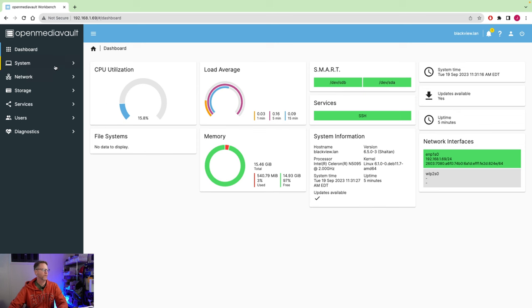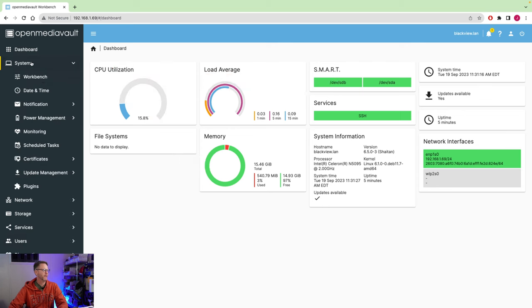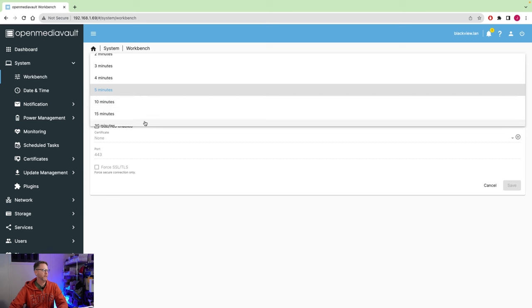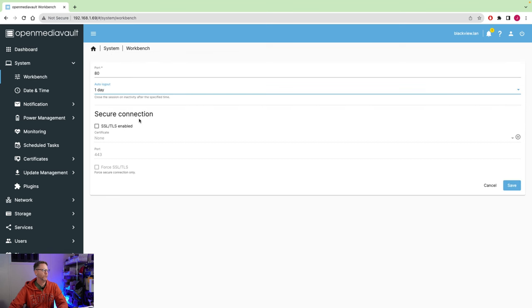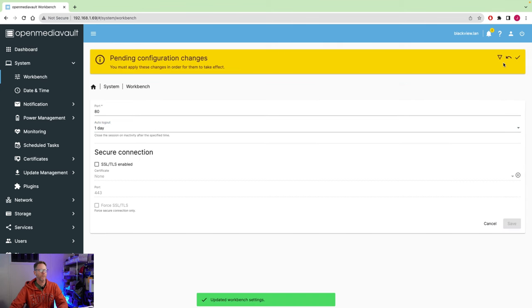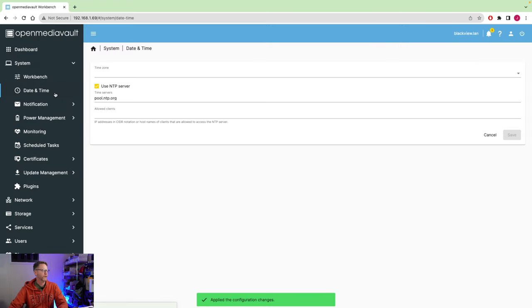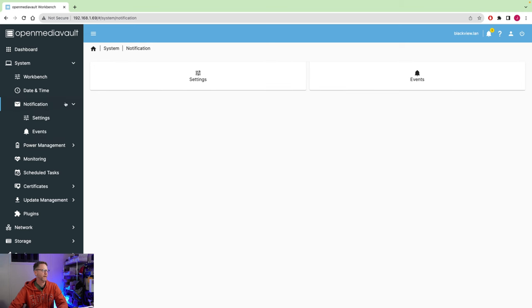Okay, so next we're just going to go down this list here. So we're going to click on Workbench first. We want to change our logout time to 1 day. Otherwise, it's going to log out every 5 minutes, which we don't want. And then we click save. And apply, and yes. We're going to check our time, so it's using the NTP server, so we're okay there.